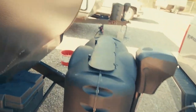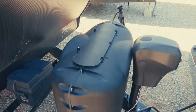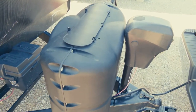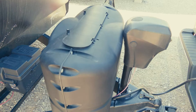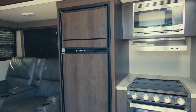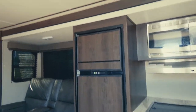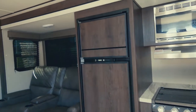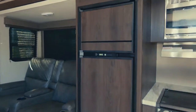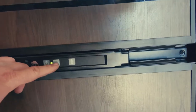The reason why we want to leave that on is if you're going to a campsite and you want a cold refrigerator, you want to drive down the road with that propane tank on, because that's what's going to run your refrigerator. If you want to show up at your campsite and have your refrigerator and freezer cold so you can immediately put food inside, the gas has got to be turned on outside like I showed you. I've got it turned on.